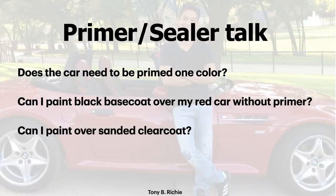If you're going to finish off with a 600 grit, wet sanding or dry sand, you want to make sure it's pretty much like a new 600 grit, okay? Because any finer, your paint is not scuffed up and scratched up enough, with enough tooth marks in it for your new paint to stick. You need some grooves, some scratches for your new paint to stick.